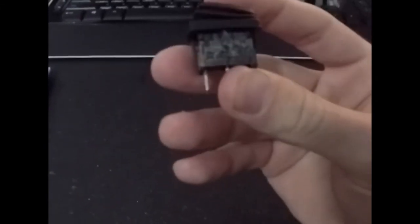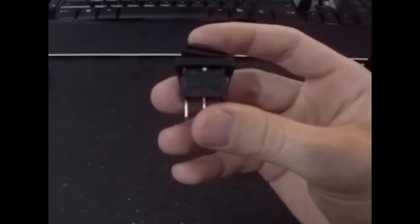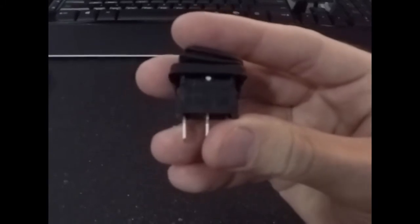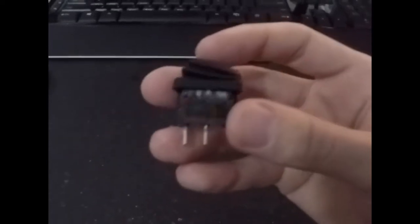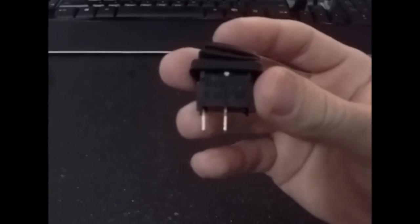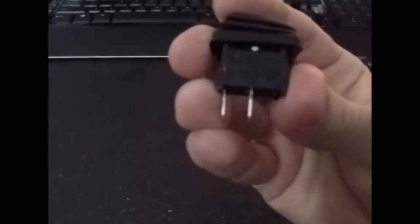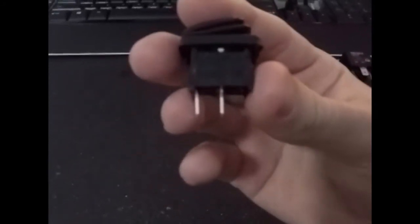So that should break as the alternating current varies between positive and negative. But DC, it's on a direct current. It just flows consistently at the same pressure. Therefore, you need to have a better breaking switch, to break any arcing. So basically, you can get pitting on the contacts. That's where arcing between the contacts creates a little bit of pitting, and therefore you can get a less effective contact when you make the switch. But I just wanted to explain that a little bit.